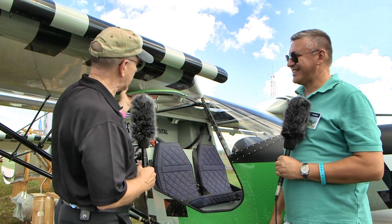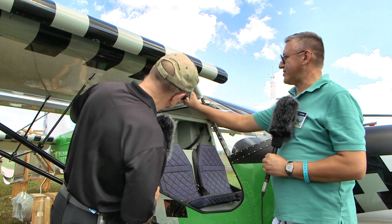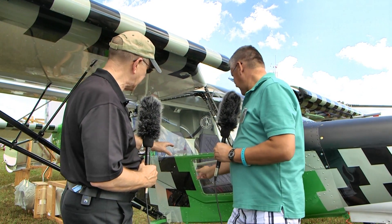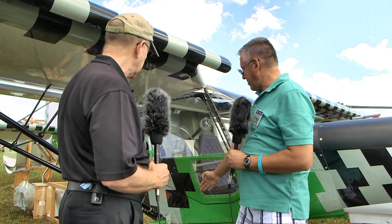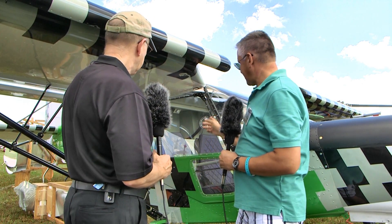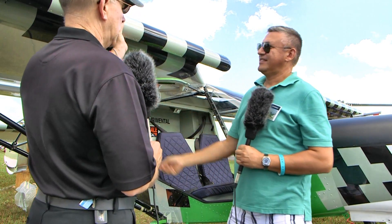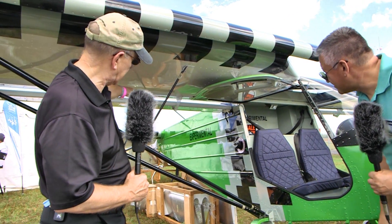It's an interesting looking airplane. The door panel is fiberglass composite, which is different from the Zenith. There's a nice little latch up top, a small extra window down below for better landing visibility, and it's bubbled out — similar to the 750 in that way. It has fixed position slats and drop-down ailerons, which you can see in the background.